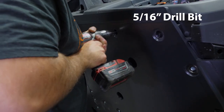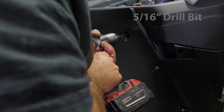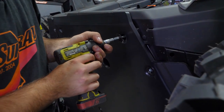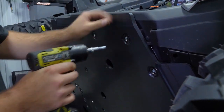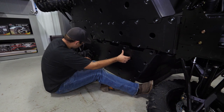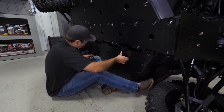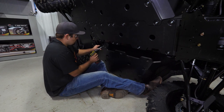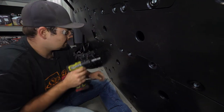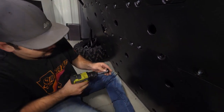On these top holes up here, I'll probably just take a drill and drill them out. Once we have our holes drilled, we'll grab our self-tappers. Now we're going to grab the driver's side piece of the skid plate, lift it up into place, shoot a screw in to hold it, and then go through and fill in all the holes just like we did on the other sections.